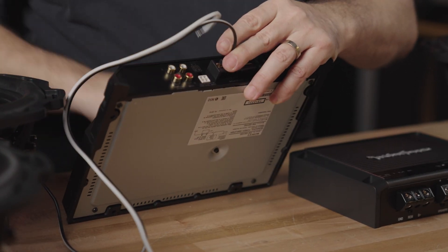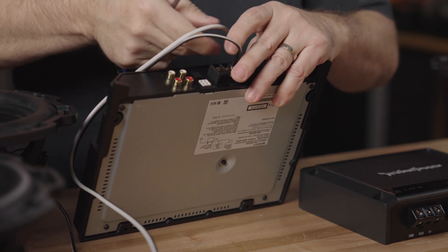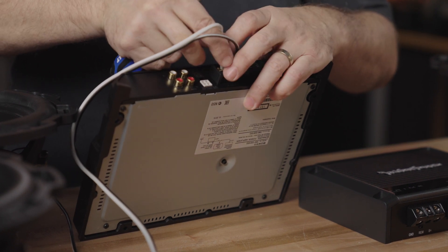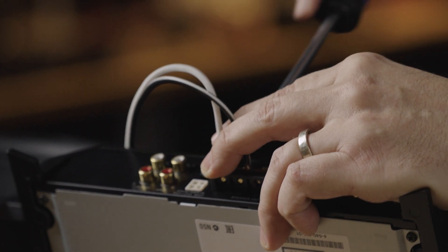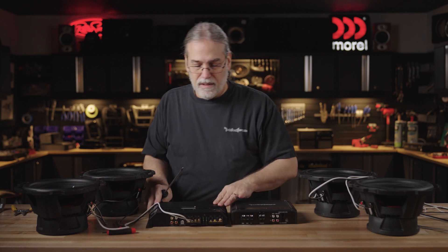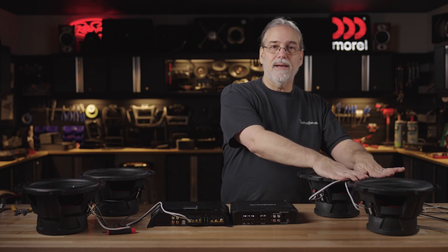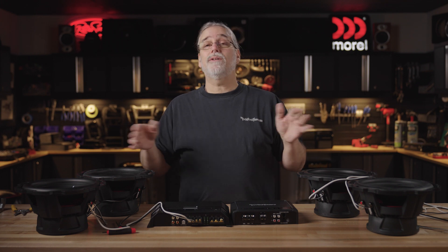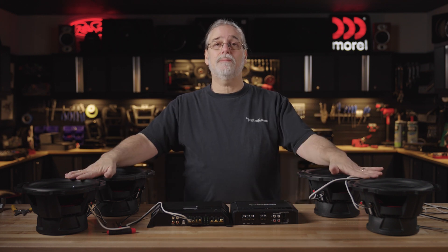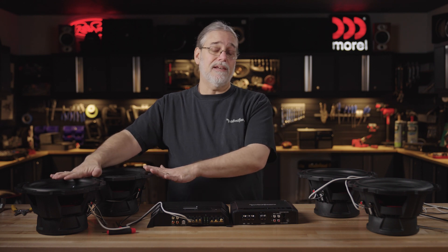These mono amps that have two sets of terminals - you don't have to use both sets of terminals necessarily. You can leave one set blank if you need to, depending on your situation. Get that wired in. So now we've added up. These two guys in series are going to extract less power than these two guys in parallel - eight ohm versus two ohm. So really it's situational: it depends on your amplifiers and your subs. There are ways to get the best, most power out, and there are ways to compromise and make a safe load so you don't burn up the amplifier. Sometimes series comes in handy for that.